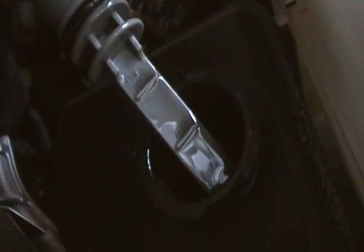Over here is the power steering fluid. To check that, there's two settings. There's warm and then there's a cold setting. It should just pop out like that. Right there, that's the cold. That's the warm setting. And over here on this side, where the two lines are separated, that's the cold. So if we want to check it, since this engine hasn't run today, take a look. As you can see, it's pretty full. So it looks good. Put that back on if it wants to get back on. And there's the trash company.